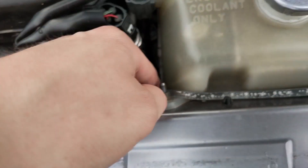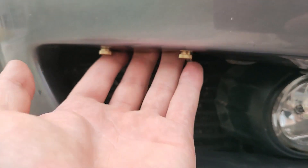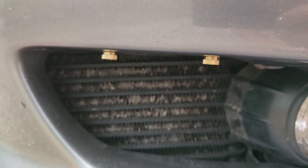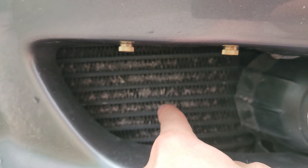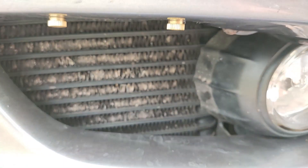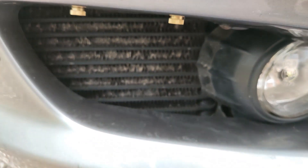It was sitting for a while so of course it starts to get warm in there. You route it down here and then you have another two sprayers on this side — same procedure as on the other side. You drill holes for these, and if you can angle them towards the oil cooler, great. If not, it still works but you have to be driving pretty fast.